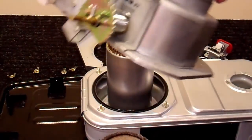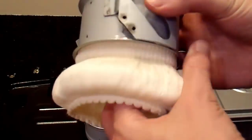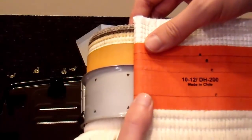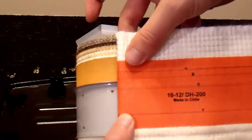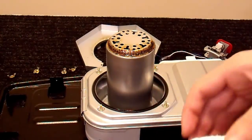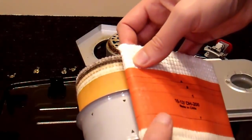And there is the wick. If you don't like kerosene smell, you probably don't want to handle this with your bare hands. At this point you can see where the wick is positioned, and depending on the brand of replacement wick, I'd recommend keeping track of the proper height when you install the new wick. In this case it looks like it is about at this second line down — line B as it's labeled here. So I'm going to install it just a little bit higher than that to give myself a little bit of extra room.